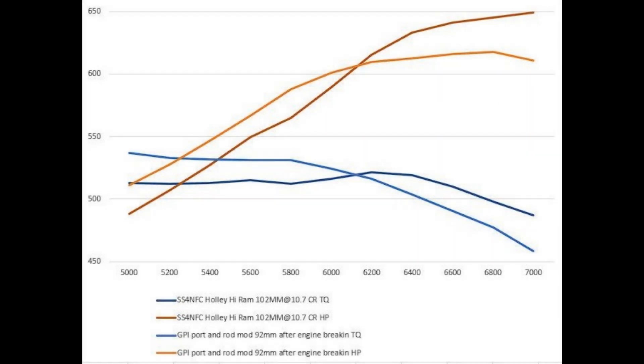Consider this dyno chart capped at 7,000 RPM — a practical limit for most run-of-the-mill heads-cam combos with standard valve trains using OEM or OEM-style lifters, 660 springs, and a solid stem intake valve. You can see that under that kind of limit, the Hi-Ram isn't even capable of reaching its peak power RPM. In fact, over that 5,000 to 7,000 RPM range, the two manifolds produce the exact same average power: 582 horsepower.